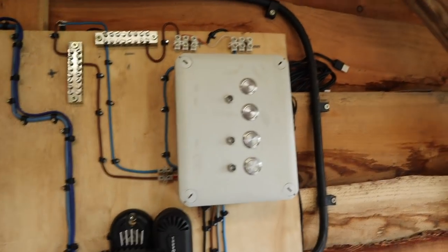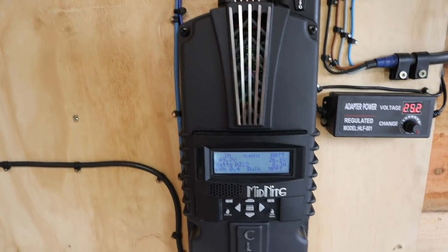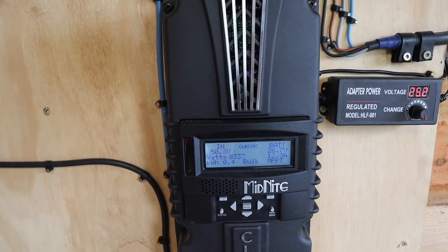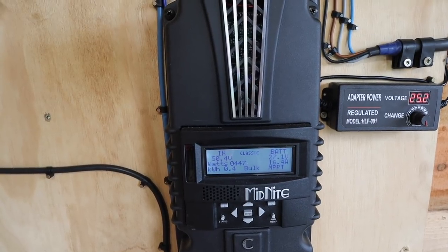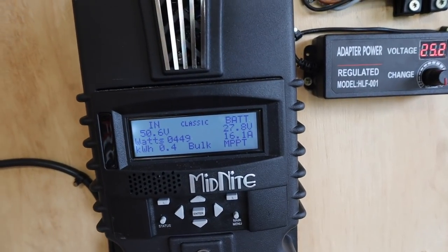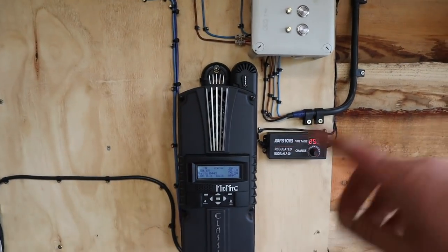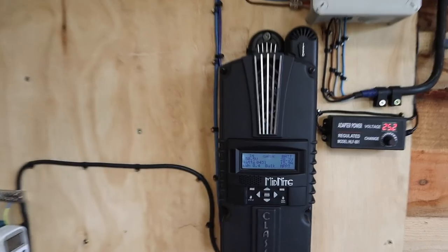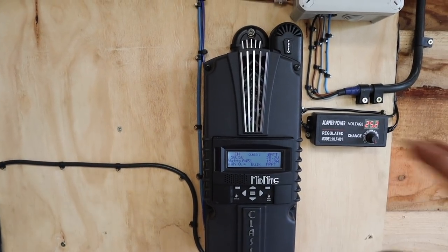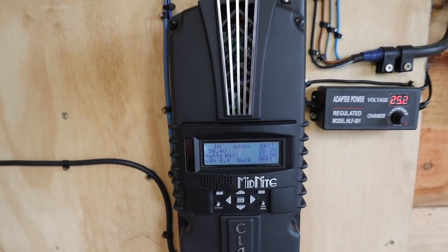We've got just the spear open and the manual open - let's see if we can get 450. It's going to be so close, we've nearly seen it already. There it is - 451, 450, there we go! Good improvement - 50 watts improvement on the top of the range. I'll admit I did tune it down a little bit to make this video, but we've got 454 and our power through the range has gone up considerably for the amount of water we're using. Still improvements to be made - we can take those 90-degree bends out - but we're up at 450 now and doing good.